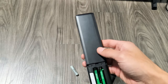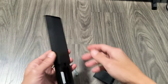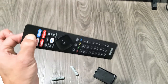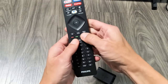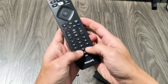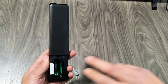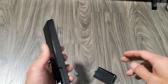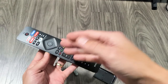If it's not working, you usually have to do this like three times to get it working. If it didn't work the first time, take the batteries back out and do the same thing again: press and hold the power button for 15 seconds, let go, then spam every single button on here. Get everything all nice and loose. If anything's kind of stuck, give it a couple whacks. Pop the batteries back in and see if your remote is working. If it's still not, do the same thing again. Try this up to six times.